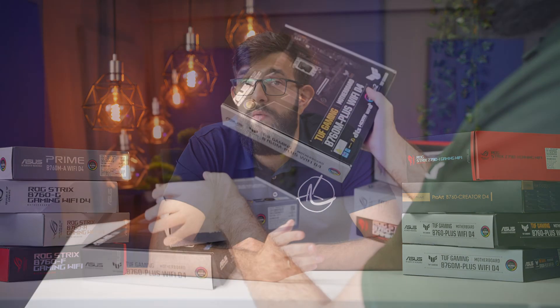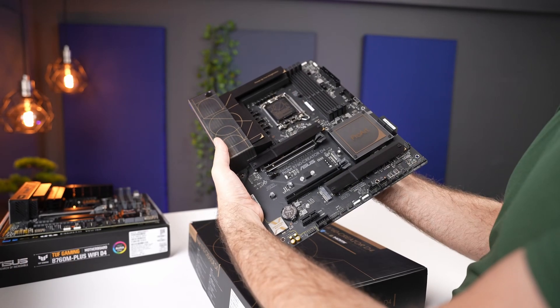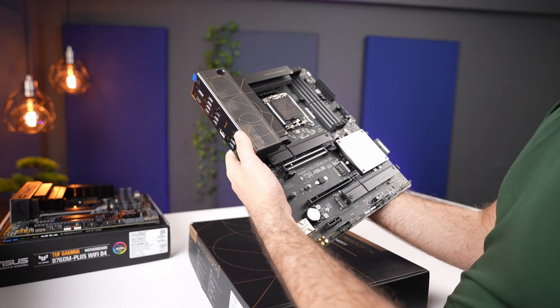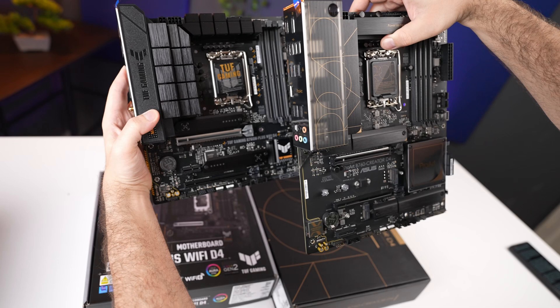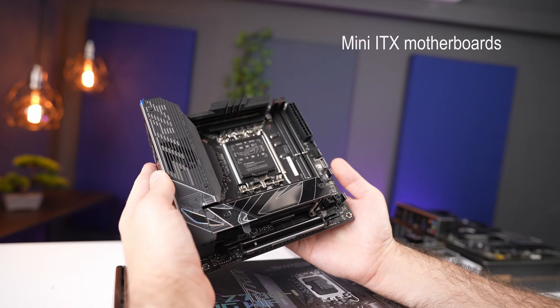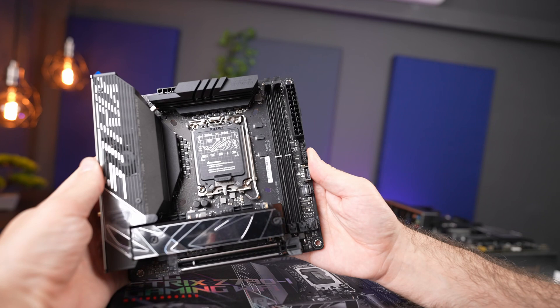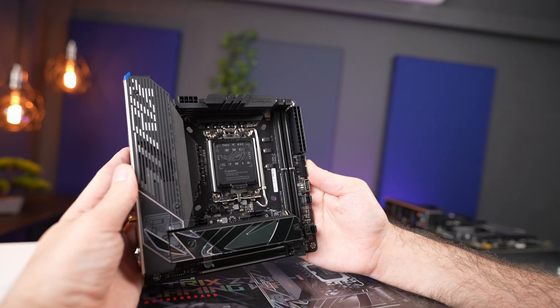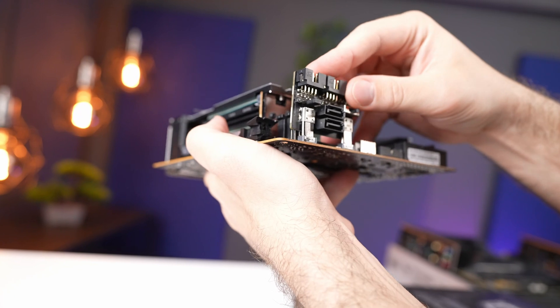There are a few places you can start. If you're going down the price-to-performance route, you might as well look at the lower-end boards straight away, but many people start their build based on the case they've been eyeing. There are three most common motherboard sizes: ATX, a full-size board with loads of PCIe and drive expansion options; Micro ATX, which is slightly shorter and essentially an ATX without the bottom quarter, meaning less room for PCIe expansion and NVMe drives; and Mini ITX, the smallest, with the fewest expansion options, a single PCIe slot typically occupied by the graphics card, and limited NVMe storage slots. Some manufacturers have added layers on the Z-axis to increase storage on Mini ITX boards, but that makes them very expensive.